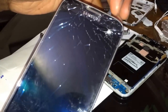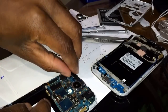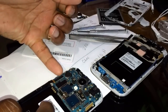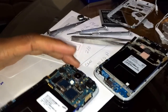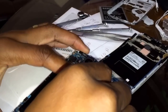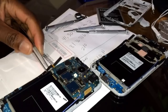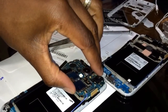Here you've got your proximity sensors, your LED notification light — that's what we're about to hook here. Here you've got your digitizer cable right here. This is the menu capacitive button here. It just wires up to the board. You'll need a pair of tweezers and a small Phillips screwdriver. Just slightly pull those up — I don't need to pull it all the way off. And the motherboard is actually ready to come out.